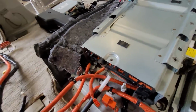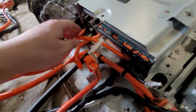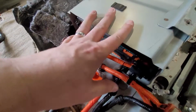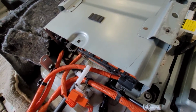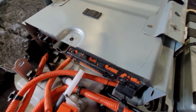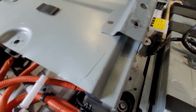And then you just want to make sure all the wires that are connected to your battery that you're going to lift out are separated. So this one and this one are no longer clipped in anywhere. This one, all the wires are on the same side. The top one is an odd number of cells, so there's an in and out on either end. This one's an even number, so in and out. Right, positive, negative, negative, positive, negative, positive, negative, and it's a series. So should be good electrically wise to pull this out.